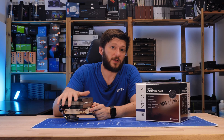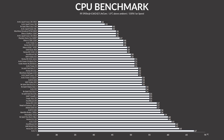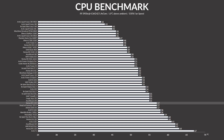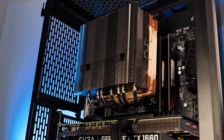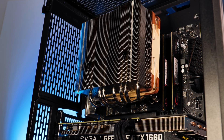Now, with all of these modes out of the way, let's go to the actually important part of this review: benchmarks. Upon summoning the devil on the 3900X, the C14S managed to cool it down to 57 degrees C above ambient. That's a solid 6 degrees C better than the smaller L12S — a very good result, considering how much performance Noctua managed to squeeze out of a C-shaped cooler. In fact, there is absolutely no cooler above the C14S at a lower build height. The closest thing I was able to find is a Dark Rock TF2, which is just weird on a whole other level. This means the C14S takes the spot as the best performing low-profile cooler at 150mm height on our regular benchmark.